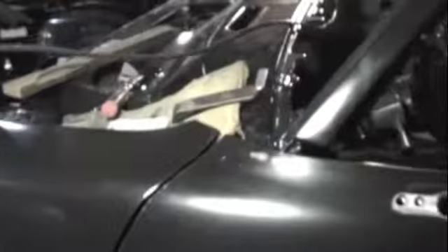You can get an idea — we're going to work on the gaps and getting the fender back every which way that we need. Then we're going to pull the front end back off again and fold that inner flange over, dolly that, and get it sitting real nice. We'll end up with a nice gap line that'll be right at three-sixteenths.